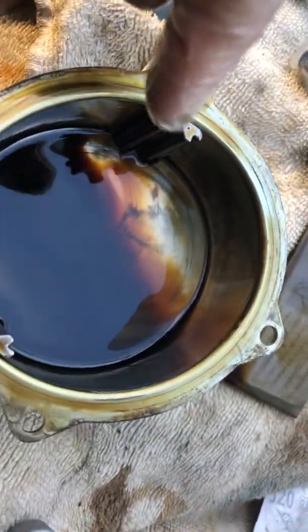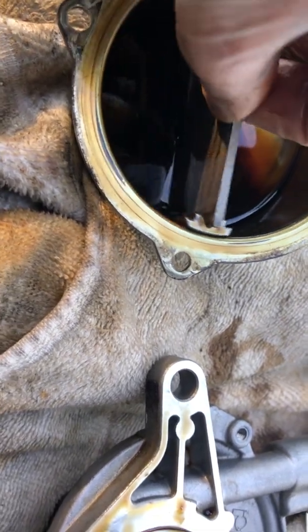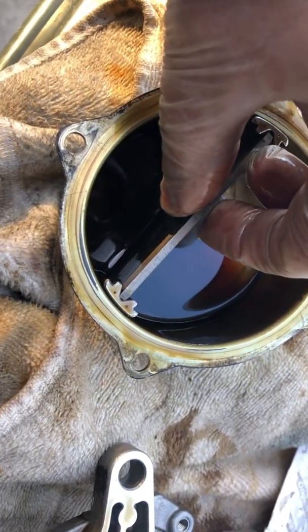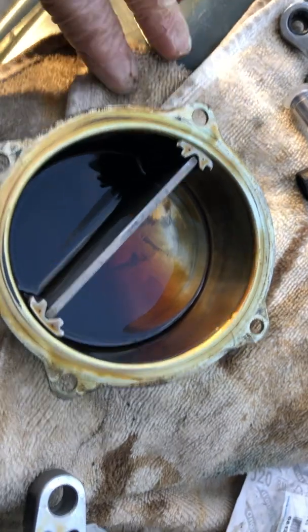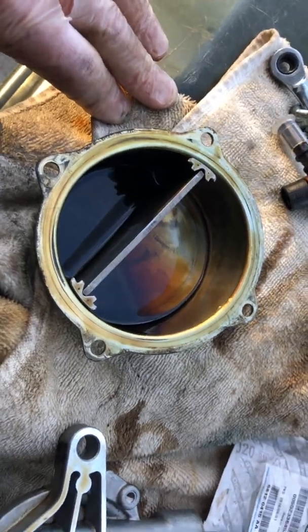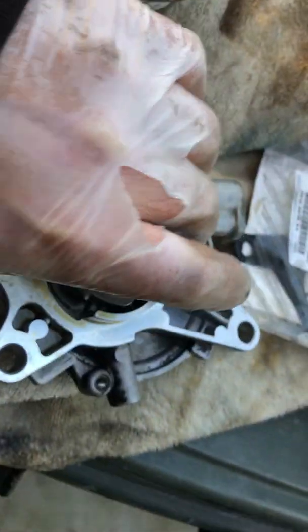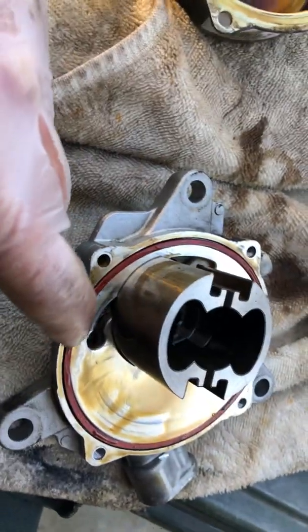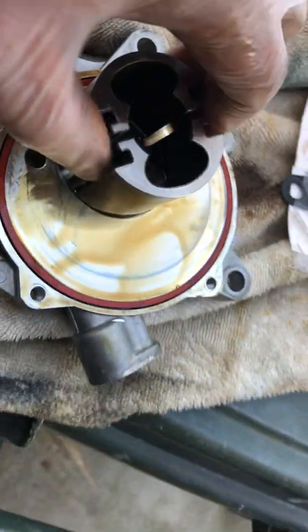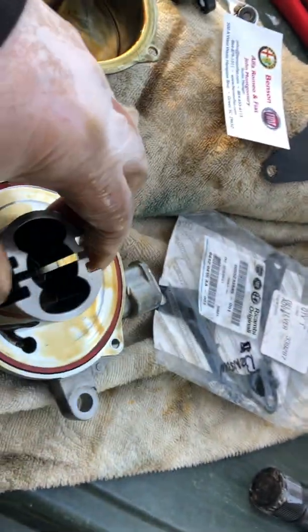Since this thing is open, depending on which way your reference is, it's going to have enough angle so it can turn. I think the reason why these things wear out is, of course, they turn thousands upon thousands of times for probably every minute the car is running. So probably what happened here is either this has worn, or more likely this gasket here started to fail and oil started to bleed through, or the seal for this rotational cam off the cam just started to leak.